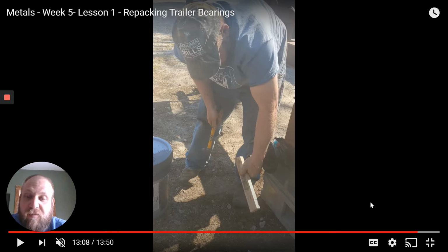What I actually ended up doing was I took both sides apart, took an angle grinder with a sanding or flap sander, and actually took the washer and made it smaller in diameter. Now, it did not hurt anything because the bearing is still riding on that wall, the outside of the bearing is still riding on that washer. I cleaned it all up to make sure there's no metal burrs because, again, we don't want anything besides grease inside that bearing. You get one little speck of sand, and in theory, it can work its way in there and just really start messing things up.